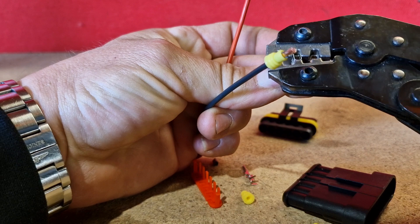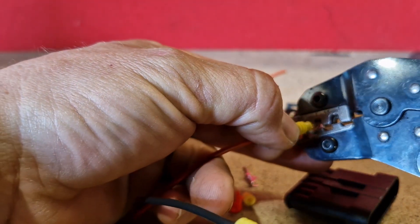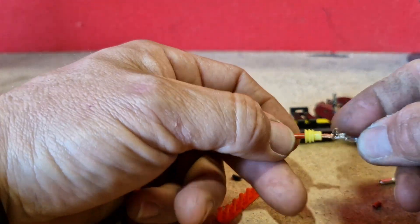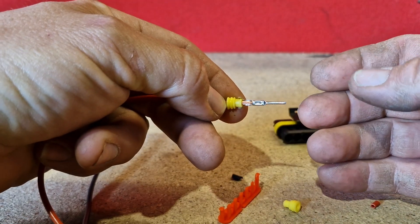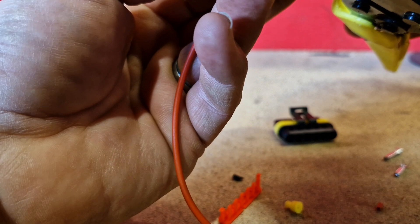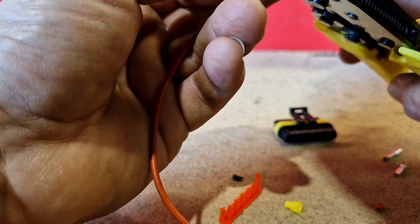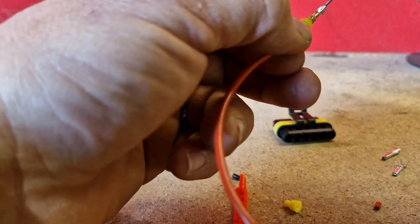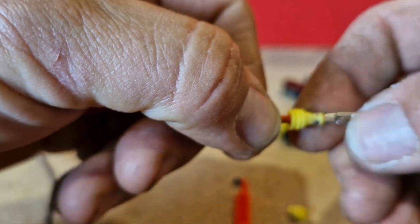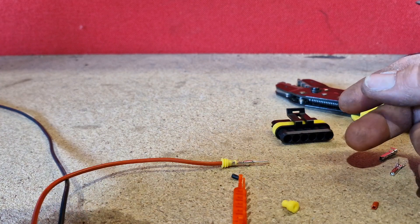Give them a slight squeeze, pop the pin in — in this one we're going for a one mil. Then slide this all the way in. You're trying to get it on there like that — give it a squeeze like so. And there we are, perfect. You can see how the cable is just underneath and we've crimped the weather seal perfectly.